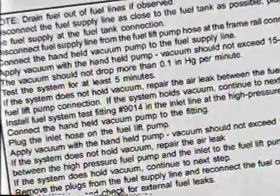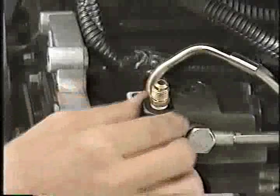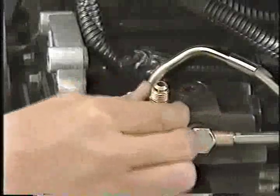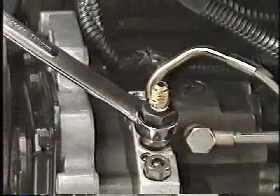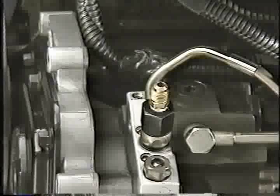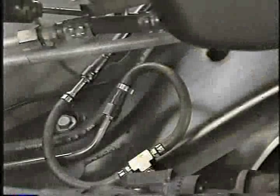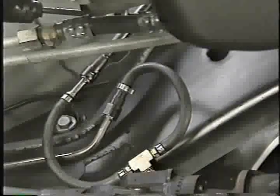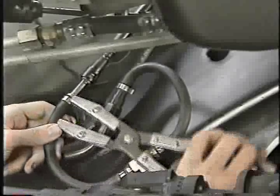You'll need to use tool number 9014 for the part of the test that checks for leaks from the transfer pump to the high pressure pump. To do this, install tool number 9014 at the inlet on the high pressure fuel pump. This blocks the pump inlet while providing access to the fuel supply line, filter, and transfer pump. To seal the other end of this part of the fuel supply, block off the inlet hose at the fuel transfer pump using special tool 6631 and clamping off the hose.